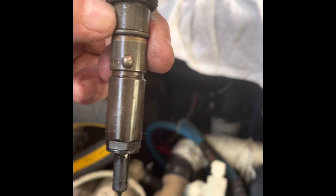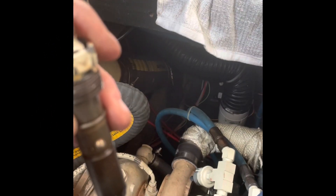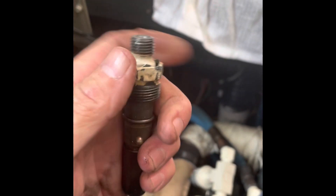The next step is pretty straightforward. There's a little ball on the injector — you just fit that into the hole. As you're putting it in, you'll see it's very easy; it doesn't snap in but you can feel it clicking in. Then you just tighten this nut.